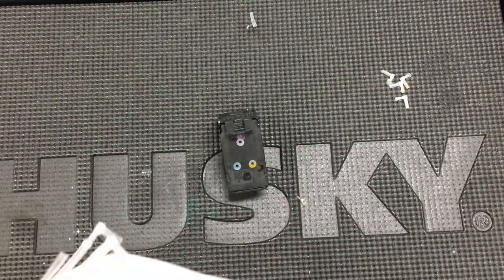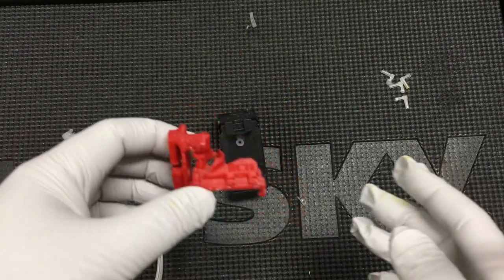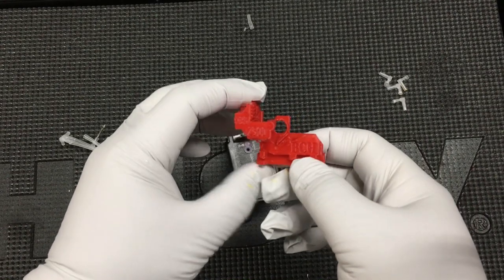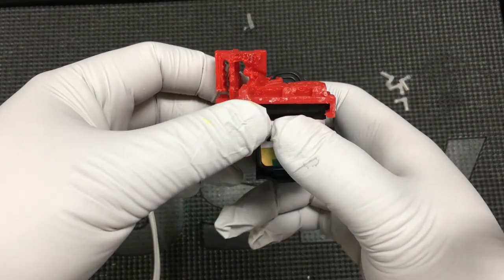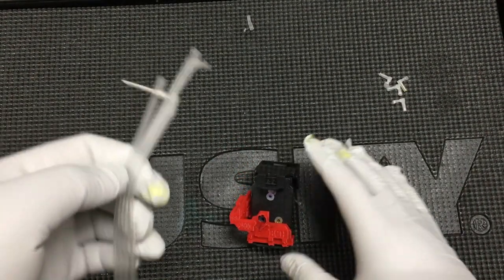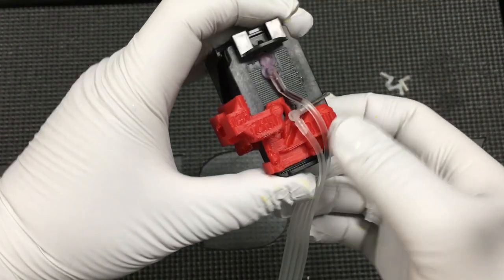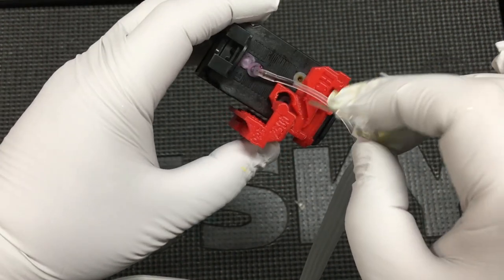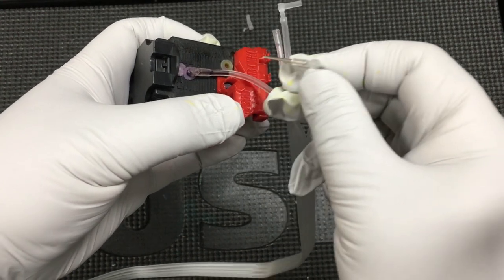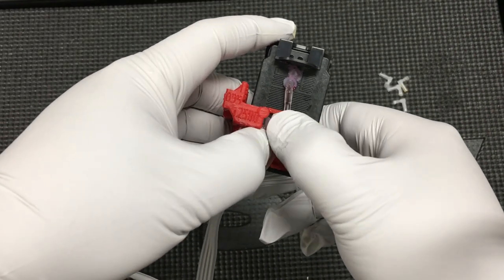For the color, you'll take all the tubes off. For each color, I'm going to give this clip for free, so if you broke your old clip when you take it off, don't worry about it. First thing you'll do is point the letters upwards and slide from the back to the color. You're going to hear a click. Now we're going to install the magenta or red on the top. The second one is the cyan or blue. You can see it's pretty deep, so when you pull your old one out, you're going to see you have a steel head and a long elbow, which is easier to have as a guide. You can just push it down.